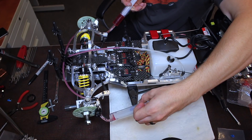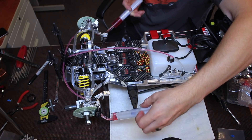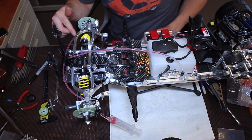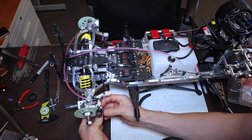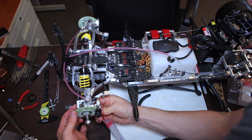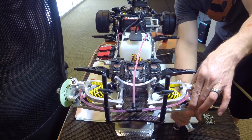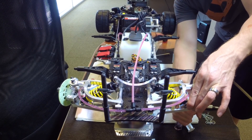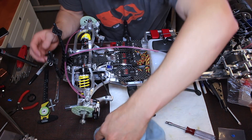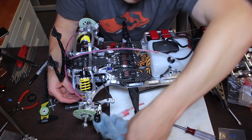You can see there's a lot of bubbles coming out of that caliper — I'm looking for it to be more consistent. You can see in the brake line from the caliper through the T-line there's no air bubbles. I'm going to loosely tighten off that valve and then torque it down. These take a fair amount of force to make sure they're tightened all the way — just make sure they're not leaking. We'll come back after the master cylinder is bled to make sure those are tightened up.